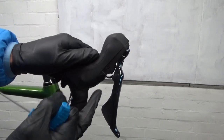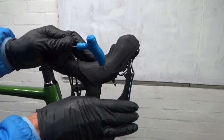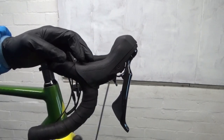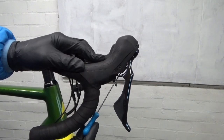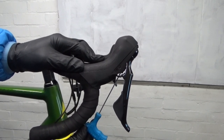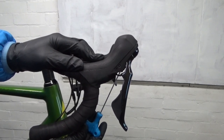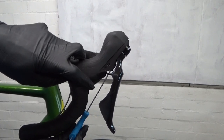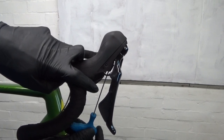If you've got these levers and you're on the drops and you can't reach the actual lever very easily, use that two millimeter hex head again - go up inside there. Turning it shortens the lever reach, and it doesn't go very far - just a few turns. If you turn it back again it winds it out. So as soon as it stops moving, you stop turning it.